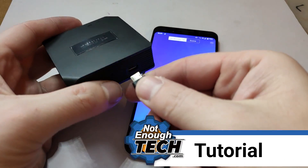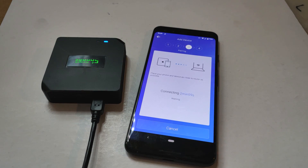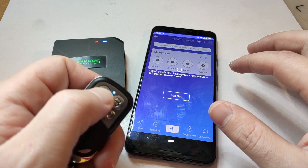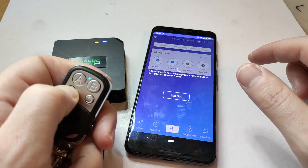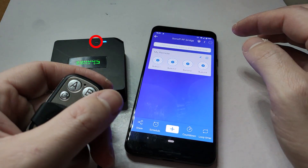To start, plug the Sonoff device in or use the pairing button if the device isn't blinking in the correct pattern. Once it's blinking, add it using the quick pair option in your eWeLink app, provide your 2.4 GHz network details, and within a couple of seconds you should see the device added to the list. Name it, and once it's there you can pair it with your remote. To pair buttons individually, hold until it beeps, then long-press the button you want to pair. You'll hear another beep — repeat for every button or additional device like alarms. When you press the button you'll see confirmation that the signal is received, and you can trigger the same signal by pressing the button itself.